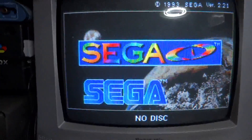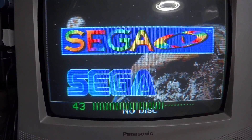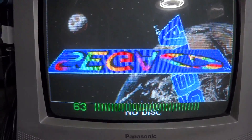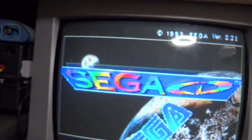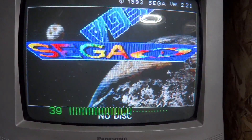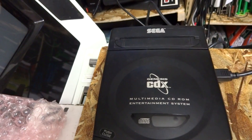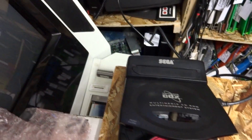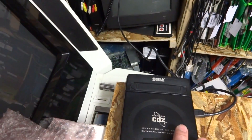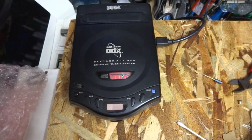One thing you can notice right off the bat — there's nothing on the display here. It looks like it's working but there's no sound. If I crank it all the way up to 63 you can kind of hear it a little bit, so that is definitely a capacitor-related issue. We're going to have to strip this thing down and see about getting that working. Apparently the system itself does not read games either, so we'll try that — yeah, it's not doing anything, no disc.